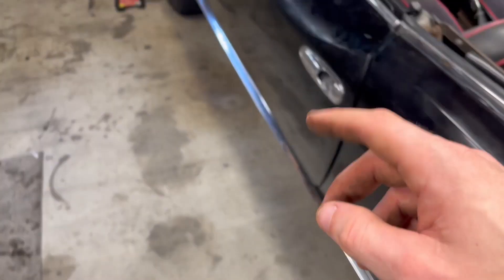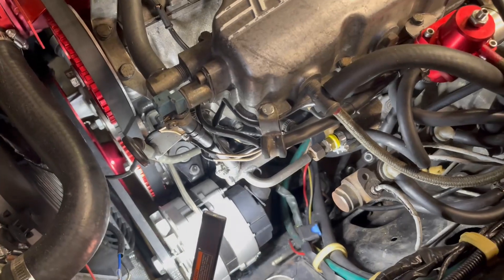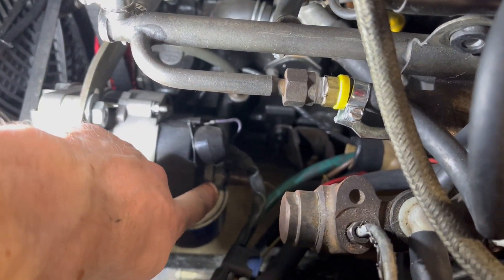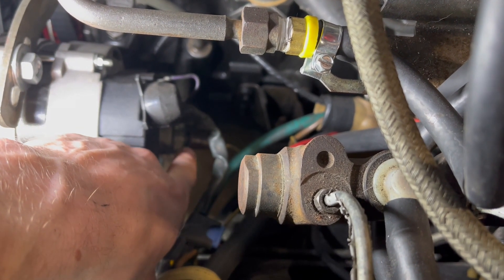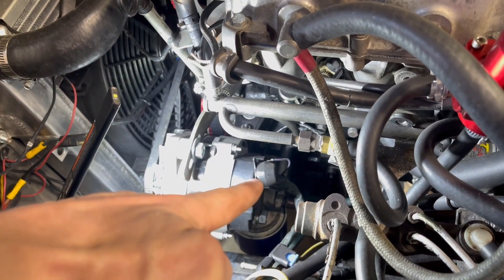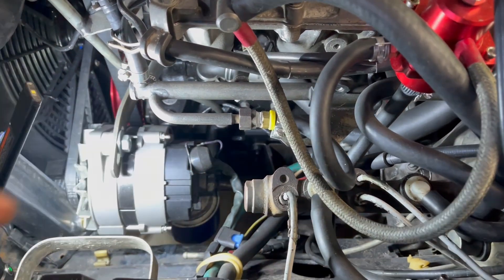We're going to go right into the car, right over here, and we're going to start working in a dark spot so I'm going to light you guys up as best as possible. We might have to remove our alternator to make our job a lot easier — only one nut here and remove the electrical. I'm going to unplug the battery as well. That's where our dummy light is, just a bolt in there that's got the sensor in it. We can back that out and add all those pieces on, reattach our wire, and run those new wires back through the firewall into the car. I'm going to disconnect the alternator, disconnect the battery, and take those wires off the back with the boot covering that so we don't shock ourselves.